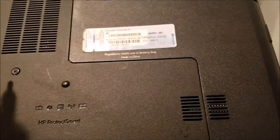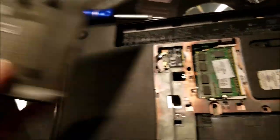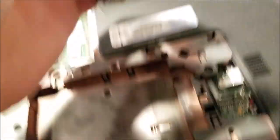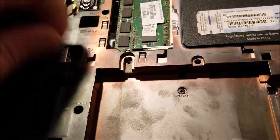One captured screw, pull this cover off, unplug the hard drive, set it aside for right now. You can go ahead and pull the pin off now while you're at it for the hard drive. Start taking out screws. Optical drive here first.